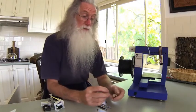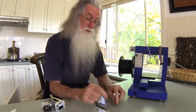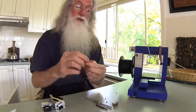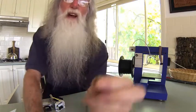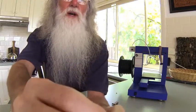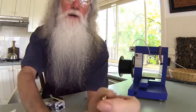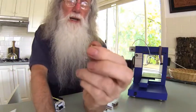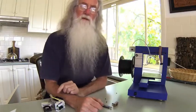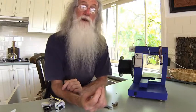So you clean it, then just assemble it in the reverse order and put it back. The problem with the nozzles is they've only got a flat and a flat — it's not a hex. So you can only grip it in two positions and they start to round off, and you can no longer grip it. That's why it ends up breaking. I hope that will solve a few problems and you get your printer head back up and running without too much trouble. Thanks for watching.